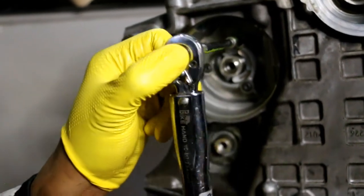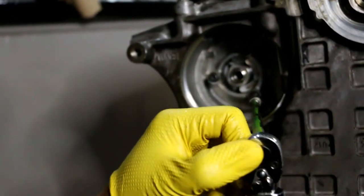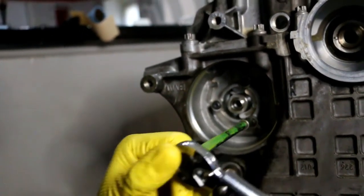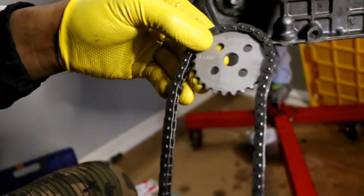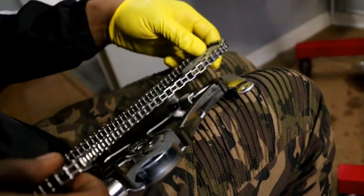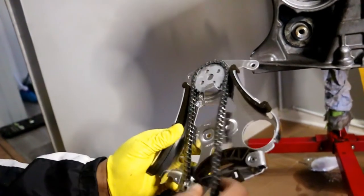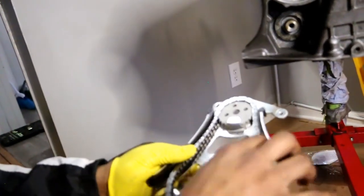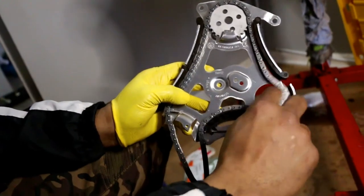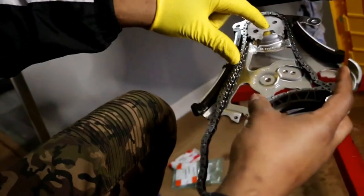All torqued — one, two, three. Now we've got the oil pump sprocket and chain. You can see this has words on one side, so that's going to be the front. We have the guide as well — the oil pump gear sets into that little groove, and this is like slide rails. One section rides over the crank hub, another section rides over the vacuum pump, and this side is the oil pump.